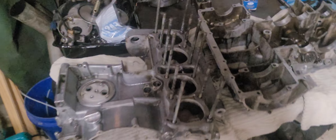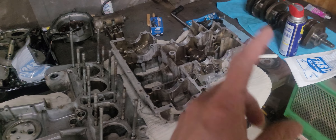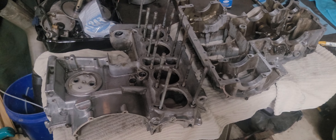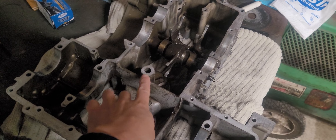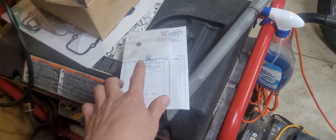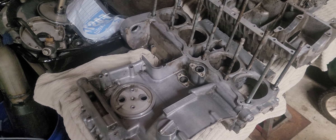Really and truly, I just need to clean up these cases really well now. I've got a new timing chain — that was the main reason to take this apart this far — and I just wanted to inspect and clean everything. I'm waiting on a seal for this main oil passage right here. I ordered one but it's not the correct seal, so I do have the correct one ordered now. There's also another seal for the oil pump that I've got ordered as well.